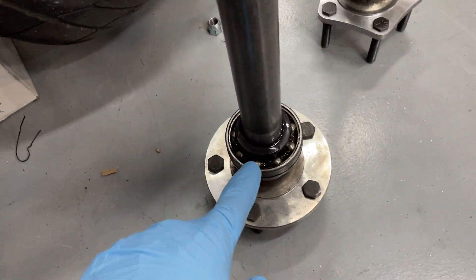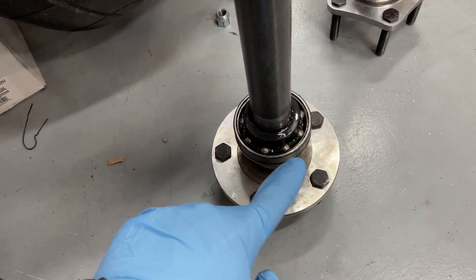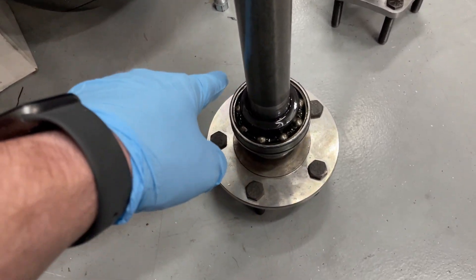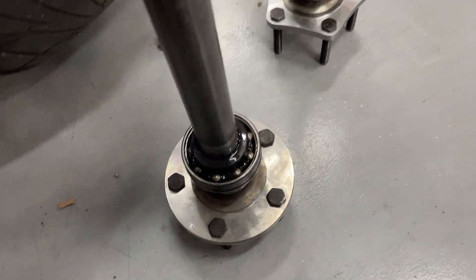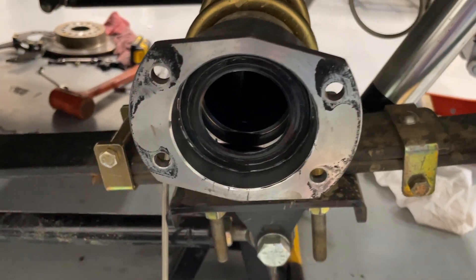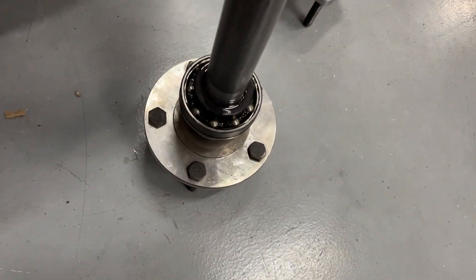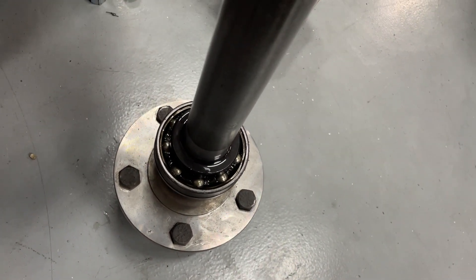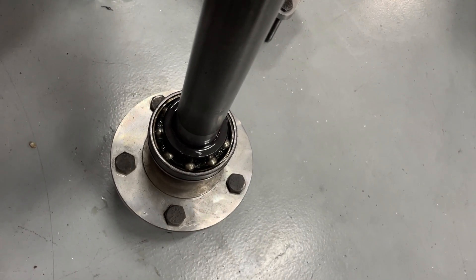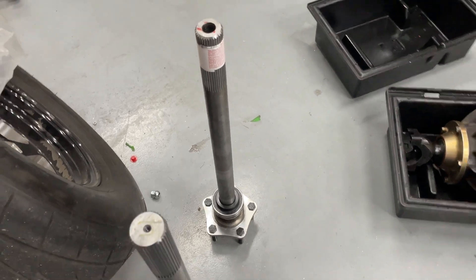Just to show you what I mean — this is my old one. When I put these seals in for my rear end housing, don't ever do this: I put silicone on it, and when it got pushed into the housing it stayed stuck in there. So when I ripped out the axles because I was just going to change the third member, it ripped out that back piece. They say it's compromised when those come off, so I could have just changed the bearings and been fine, but I was going to switch axles anyway.